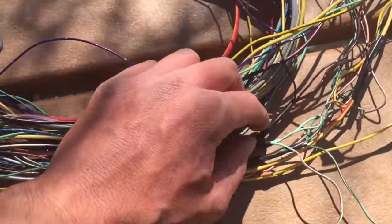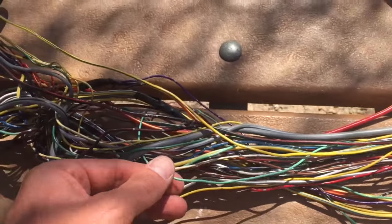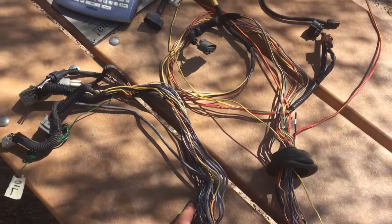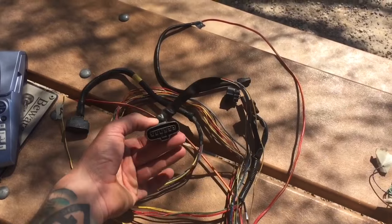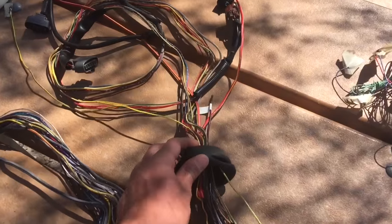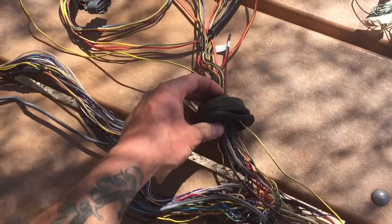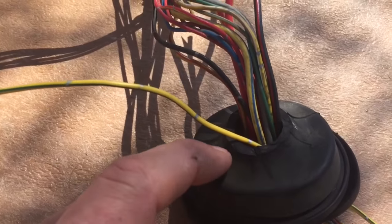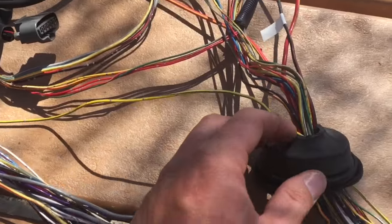Working our way down the harness, we see some more dead ends — same as with the battery connection we clipped: peel the tape, clip those short, and retape. Now we continue down toward the engine connectors. It kind of makes a T or Y shape here. We've got engine connectors here and other engine-related connectors — the igniter, mass air flow sensor, pressure sensors, and the start cable. We're going to stuff all of these wires through this grommet. We need to cut the diameter slightly larger to fit the larger connectors through, but with some patience you'll be able to get it.